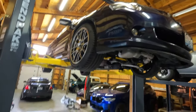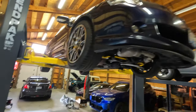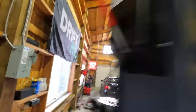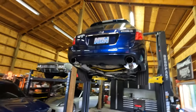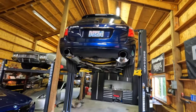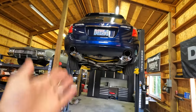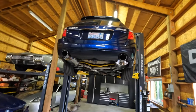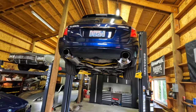If the check engine light goes away, I'm hoping the car will run better. I don't know why it's running this way because a speed sensor is not necessarily related to any smoke, and that's why I'm concerned. This car doesn't have an air oil separator on it — it desperately needs one. I have one sitting in that cabinet, so I'm going to install that before I assume the worst and think the engine might be on its way out.